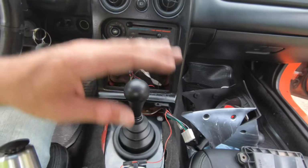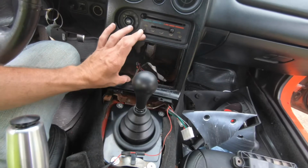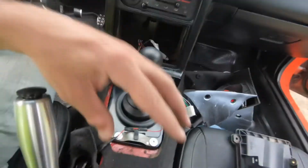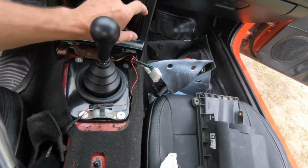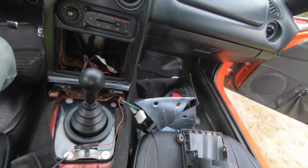It's constantly draining from the battery, so I want to be able to flip it off with the switch. And then I've got from Top Miata, I also got the panel that's going to go in right here. Let's see, the switches go on the bottom. It's got toggle switches for the windows, so it'll relocate them from here. I'm gonna keep the power windows. I thought about going manual, but then I saw that switch housing from them, and I was like, man, I gotta have that. So that's gonna be awesome.